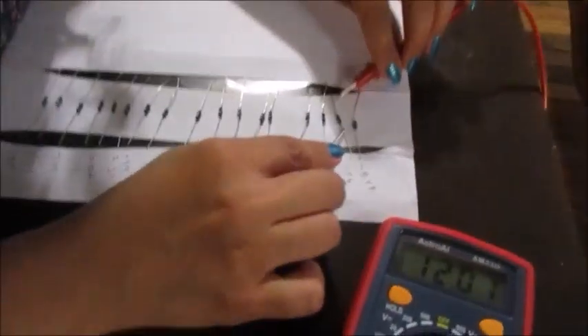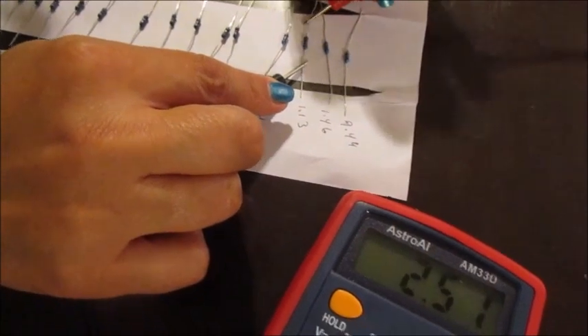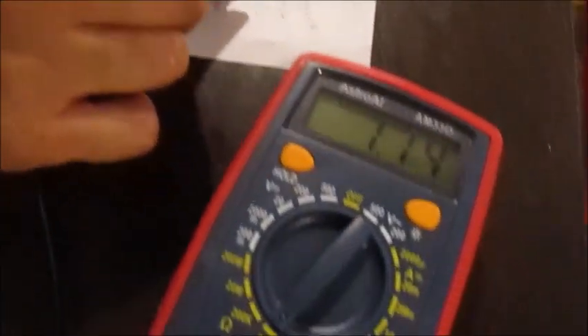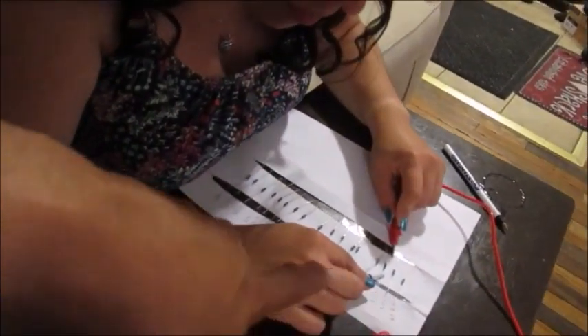We're doing this so when we get out to the car and take the column apart, we can check the ohms on the wires under the column. All you do is put your testers on one end of the resistor — positive on one end, negative on the other — and it'll tell you how much ohm resistance is in that resistor. These resistors were unlabeled, all 15 in one pack. If your car reads something like 25,400 ohms, you have to add resistors in a chain to get the resistance you need.